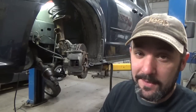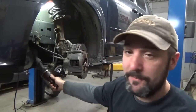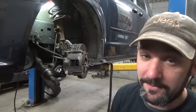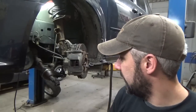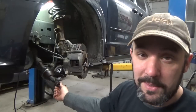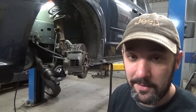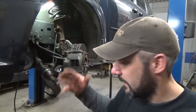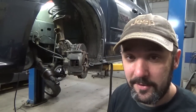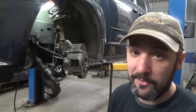That's a shame that axle is kind of goofed up, out here on the outer part of the joint. It's just stiff. I don't dare reuse it. So obviously it couldn't take the shock and the beating of the press, but we had no choice. We had to push it back to get the nut off the stud on the ball joint. And we could have, like I said, pickle forked it down, but it just creates a different set of problems. This eventually would have had to come out.